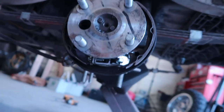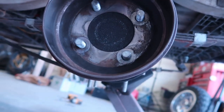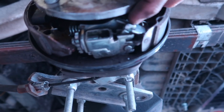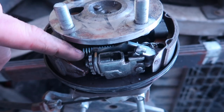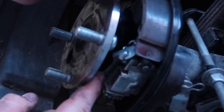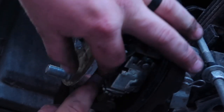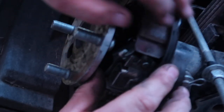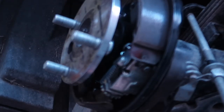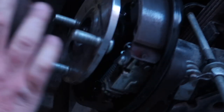The adjuster is flat on one side and angled on the other. Every time you push your brake pedal and the brake cable pulls forward, this adjuster pulls outward and needs to pull against this little gear on the flat side. Right now it's in a locked position out front - it's not doing that. See, it lines up fine but you can't push it back on. It goes on backwards just fine, which tells us the brakes have pushed outward too much. We need to take this arm connected to the adjuster and put it between the adjuster gear and the brake axle.